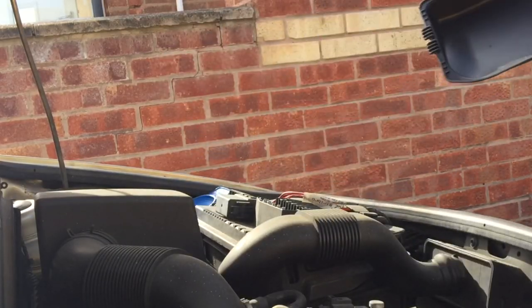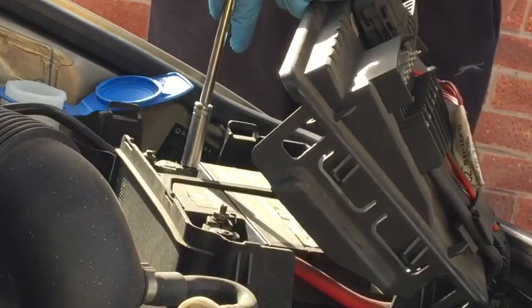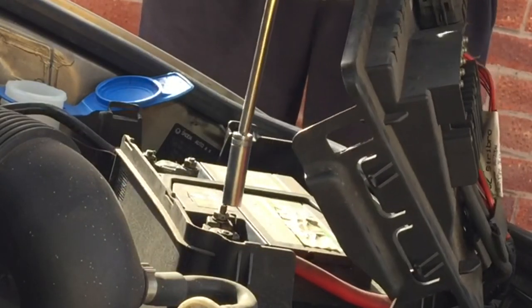So let's get stuck in and start to pull it apart. First things first, on these you've got these plastic covers - just pull the clips on the side and pop them off. The top of the battery cover comes away, and you're left with the second one. You've got to remove the power lead and the auxiliary power lead that goes to the little fuse box on top of the battery cover. Whip those out and then we can pull forward the second cover.